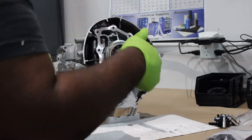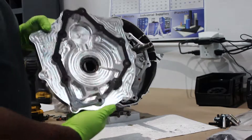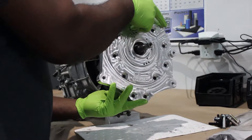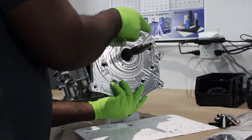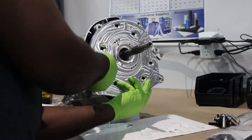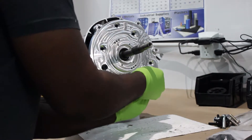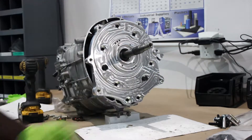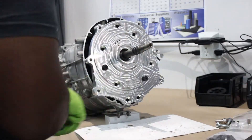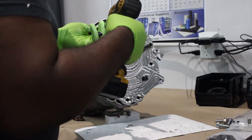These have the deeper recess pocket from a couple years ago that clears the shaft, so you don't have to worry about notching — there's a lot of misinformation going around about stuff that's been fixed like two years ago. So we'll go ahead and drop this on. Try to keep the plate centered just so you don't have to worry about touching the lubrication on the seal. Drop this down, start one bolt here, and start another one right here. It's best to get all of them started before you start trying to tighten them.